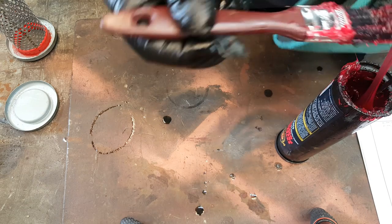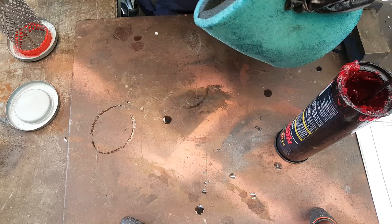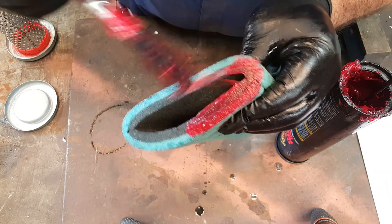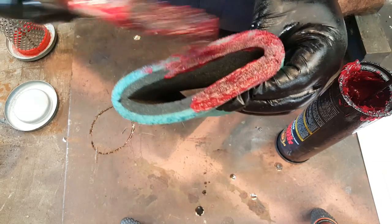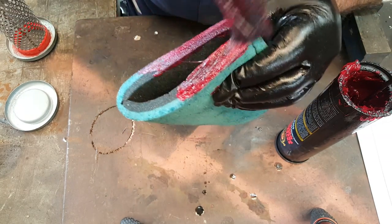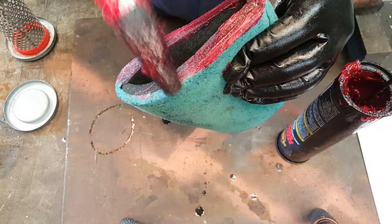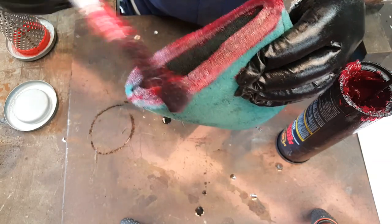And just standard sort of lithium grease is fine. You don't need tons of it. What you're trying to do is seal the whole thing up. And that's important because you don't want dust, especially in really dry, powdery, dusty environments. The dust can easily bypass the filter, get round the ends of it, and it'll still go into your engine, and that's not good. It's going to cause lots of wear.